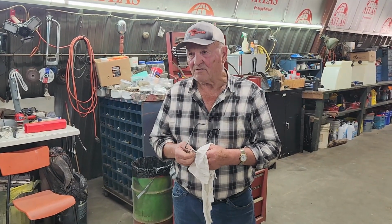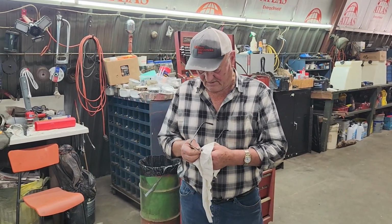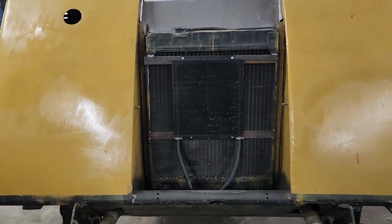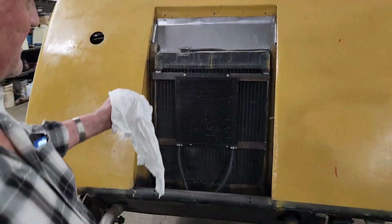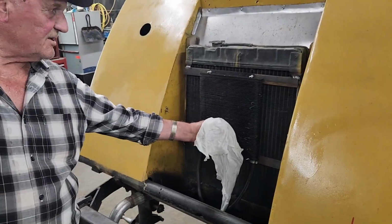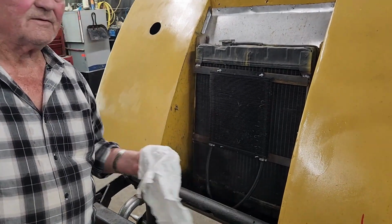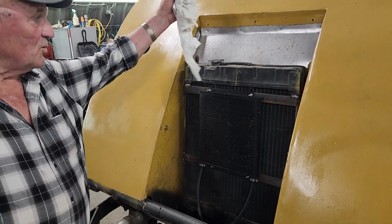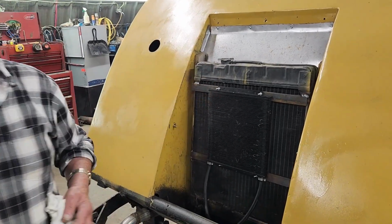And the transmission has to have a cooler on for sure. This is what Dad's referring to. This is a transmission cooler here. So this is the rad. The cooler should be high on the rad, because there's no pull in here. It's either on the top or the bottom. Okay. So naturally, if you put it here, the cold air comes over and it sucks in right away.